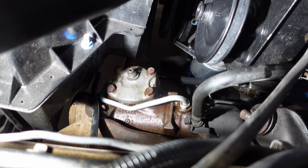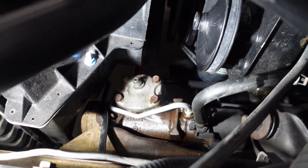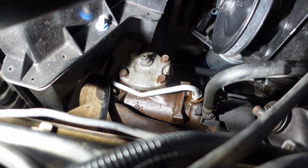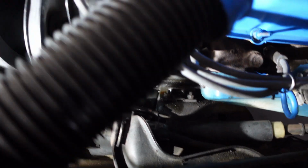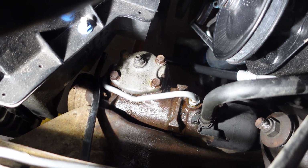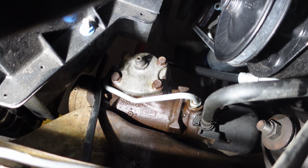Finally, we got the new steering line in. Power steering's been bled out, so I think we're good. We're just gonna take it back in the wash bay, clean everything out on it, and clean the car up. We're gonna enjoy the rest of the day. So y'all see it, this job actually wasn't hard. It's probably a 30-minute deal, less than that if your line don't get stuck, but like I said, I had to cut the line off and put a new one in.